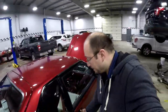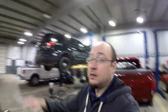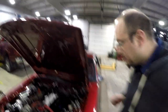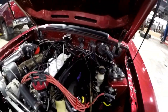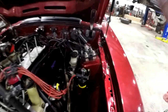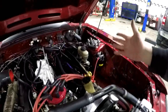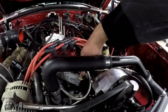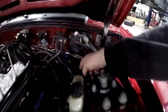Let's go ahead and show you guys the passenger seat here. Terminator X time. So let me give you guys an update of what we've gotten accomplished so far. We got some of the new Holley stuff in and we got some of the old stuff out — kind of in the middle of everything right now. The big thing I wanted to show you guys is we got the factory wiring all complete so all the gauges will work, and the TFI harness right here — the wire that gets the signal from the coil — all spliced in, all ready to go, and we taped it up with some nice Holley loom.